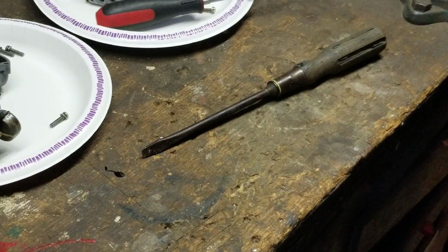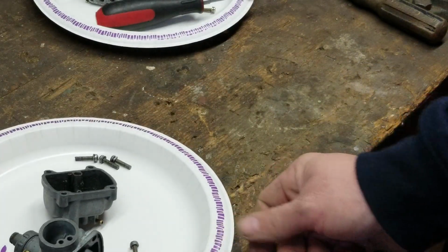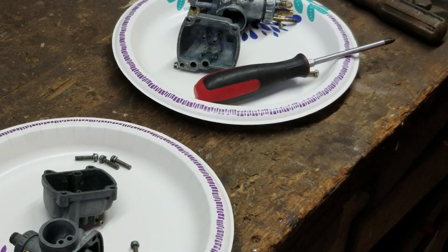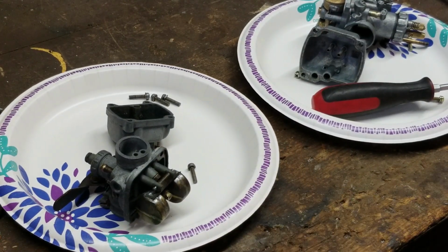As a mechanic, I use them both, and I even use the Walmart branded carburetor cleaner. Just be careful with the Walmart carburetor cleaner if you try to start an engine with it, because some people like to do that. It's non-flammable, as I found out the hard way.